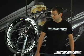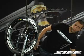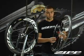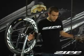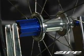The last thing I was going to touch on is the lacing pattern on the rear wheels. I've got a 2008 303 right here, and this wheel you'll notice has 2 cross lacing on the drive side and radial lacing on the non-drive. For the 09 product, we've actually basically reversed that. Radial lacing on the drive side and cross lacing on the non-drive.